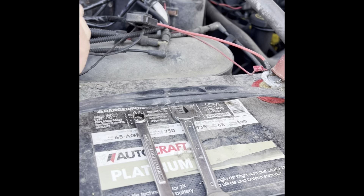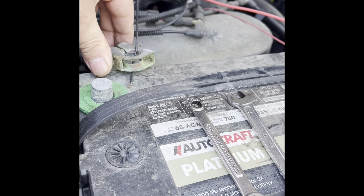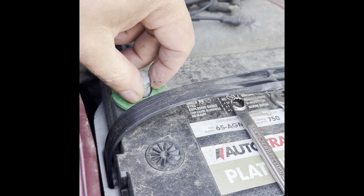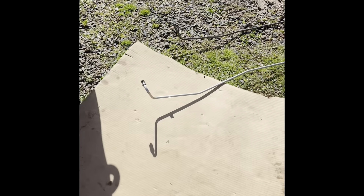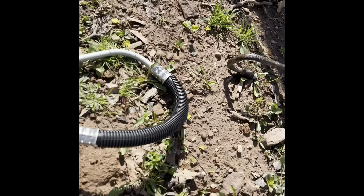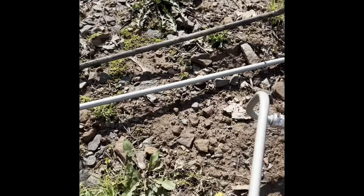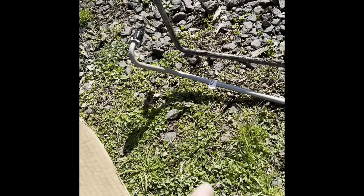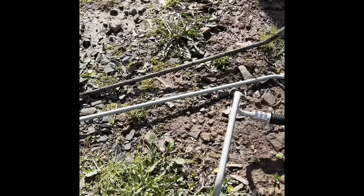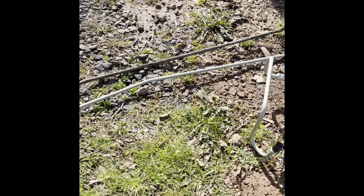If you've got the original connections it's going to be 8mm — make sure you disconnect them and pull them to the side where it's not going to touch the terminal. The new line is going in — I taped the ends, I don't want to get dirt in the new one. I didn't bend it much — I ended up tweaking it a bit but it looks pretty much the same. You don't have to force it that much. I'm going to stick this side in first right in the center where it goes, and work it in. Take your time, have patience — if you get frustrated walk away, go get a drink of water. You don't want to kink it or damage anything in the process.